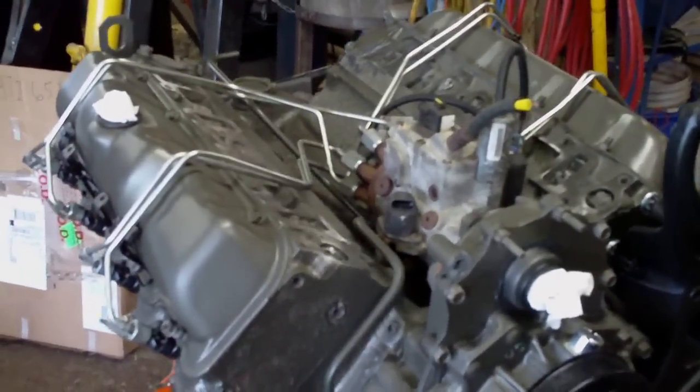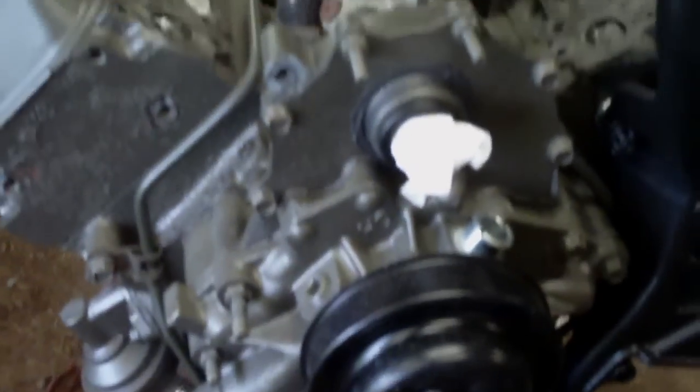Here's a helpful hint if you've not kept track of which lines go where. The injector pump, as seen from the front, rotates counterclockwise. Which means that your firing sequence would be going from here down in that direction.